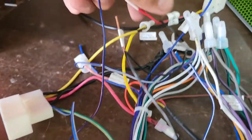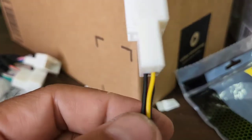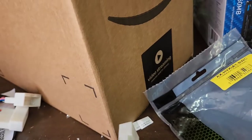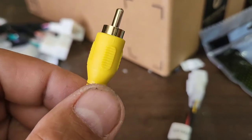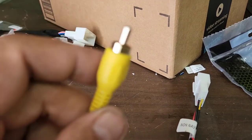The black wire you want to hook up to ground. Then the blue and red — you want to hook that up to the plug from the harness that we have. And then you're gonna have to hook this yellow wire up to the rear camera — it should say 'RC' then something on the back of any radio, or 'rear camera'; it will say that. And if you're gonna do a steering wheel control, you're gonna need to hook up the SWC to this green and yellow.